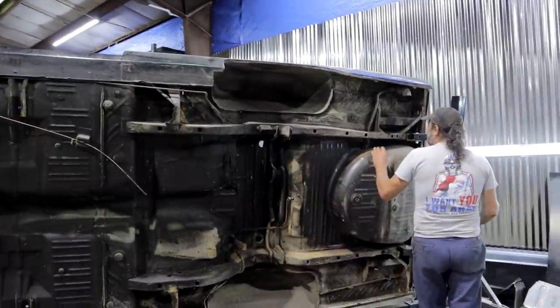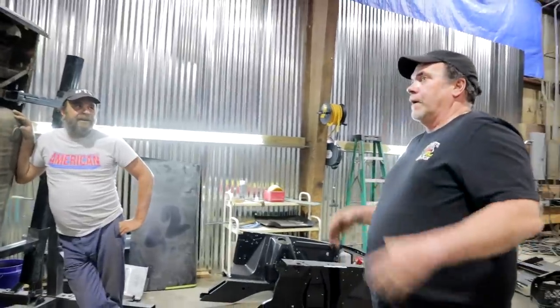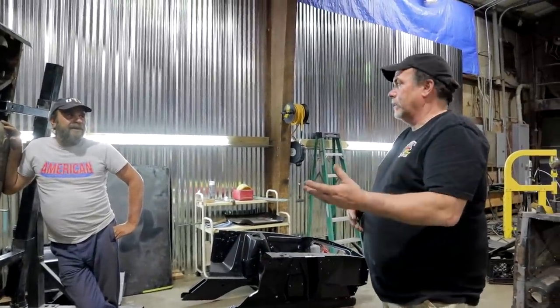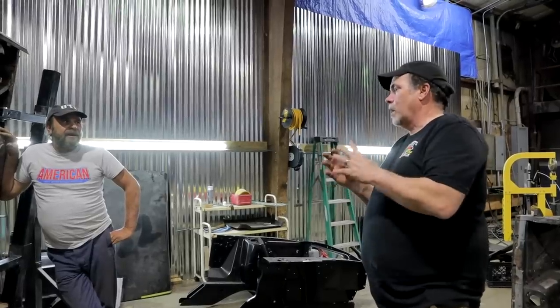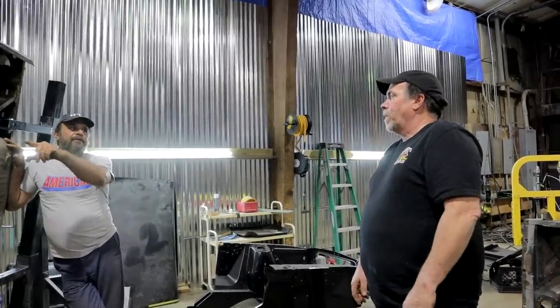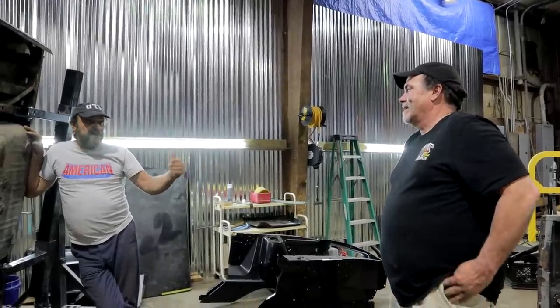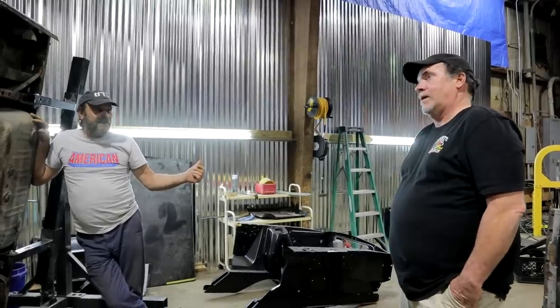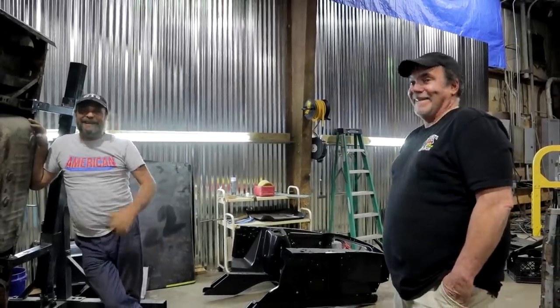So what's the timeframe on this — when is it going back together? Shortly. We're going to start taking the motor apart tomorrow, then redo the rear end, and convert it to disc brakes in the front using regular Chrysler parts — not an aftermarket disc. I'll buy the front drums off this thing because I need them — I've got disc brakes on one of my cars. Let's just swap. Let's do that. Score.